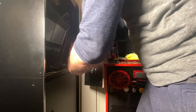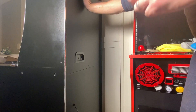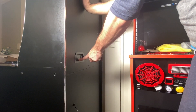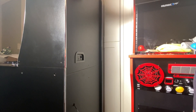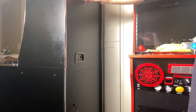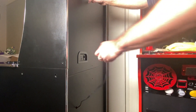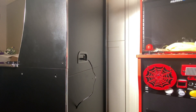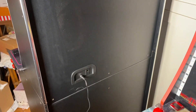We're going to take these two DC connectors and plug them in on each side, then reattach our cable. The other thing I did — and this is totally up to you — is instead of plugging the 12-volt adapter that comes with your Arcade1Up into the wall separately, I wanted everything off one power strip. It's actually an Alexa-enabled power strip so I can just tell Alexa to turn it on. I drilled a little hole for the cable and plugged it in that way. I just reattached one screw so in case we need to get back in we can. The back is all tidied up — now let's go to the front and set up things in the software.